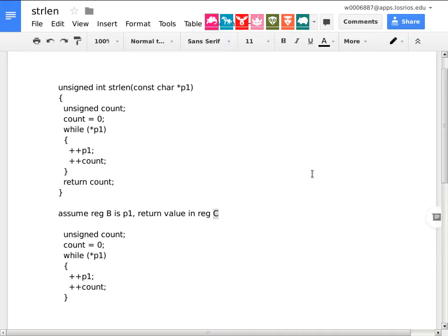But optimization these days gets a lot harder because a lot of stuff is done inside the processor at runtime, in real time. The processor can reschedule the execution on its own to optimize its own internal pathway. So the number of clocks it takes for one instruction to execute is no longer quote unquote predictable.